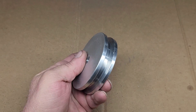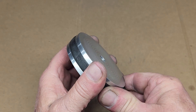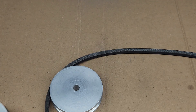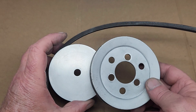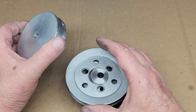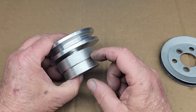We're done with the basic shape of the pulley. I went ahead and eased all the sharp edges and whatnot — let's see how the belt fits. Not too shabby. It feels like the belt has good traction, and it seems to fit really well — that's good enough for me. Here's a good shot of the size difference between the new and the old pulley. It's hard to say if this is going to be enough to make the difference we want in order to generate more boost from the supercharger. Now the very last step is to modify the pulley adapter to allow our newer and thicker pulley to occupy the same space as the older and thinner pulley, and while we're at it, we need to drill some holes in the new pulley so we can bolt all this stuff together.